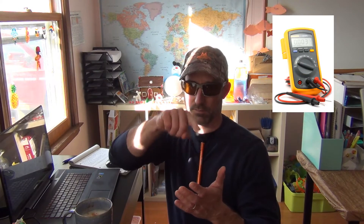You can prevent this with some battery winterization steps, which are pretty simple. The first thing is to check and continuously record — once a week or once a month. Use a voltmeter and actually check the voltage reading on your battery. Put your voltmeter on volts, make sure it's on DC current — not the squiggly line, which would be for your house. Take your positive and negative probes across the terminals and read what it says. It should read 12.66 on a good battery, which is 100%. That means your battery is good — it's healthy.